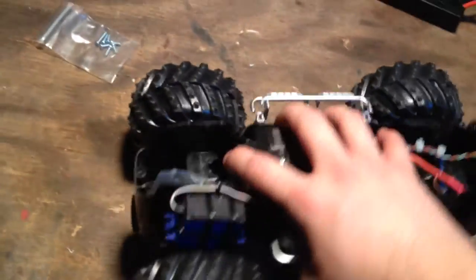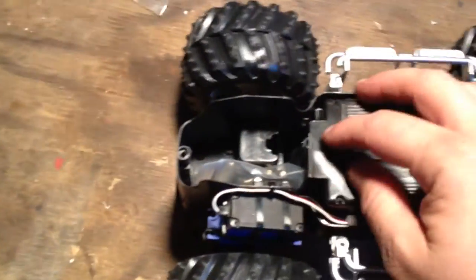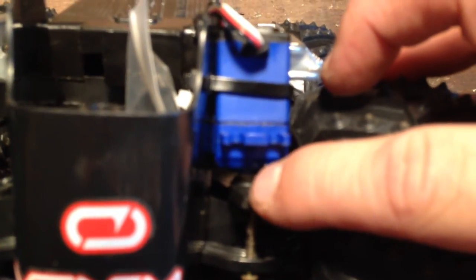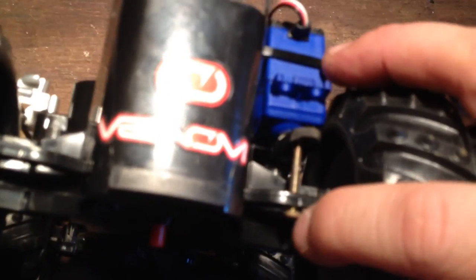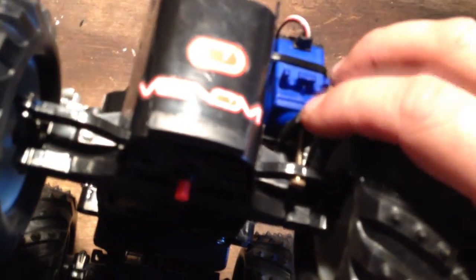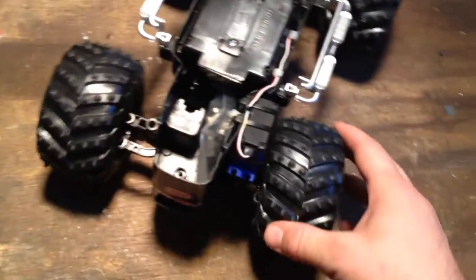The steering I am using — the funny thing is, this is actually all waterproof, just because that's what I happen to have laying around. I am using a Traxxas 2056 waterproof servo. How I hook this up — I know this is very rigged up and I don't care. I got the servo horn coming right off of the servo. I've got a screw — it's actually a metal screw, but it works just fine. I drilled out a hole in the steering arm, the steering linkage that comes across — just drilled a hole right through that plastic and put the screw up and screwed it into the horn of my servo.